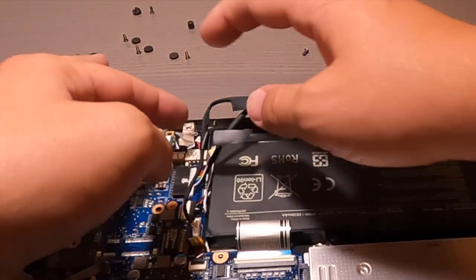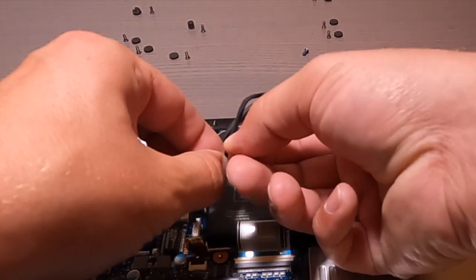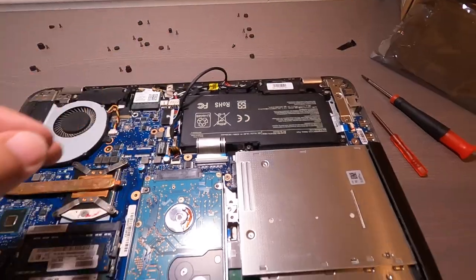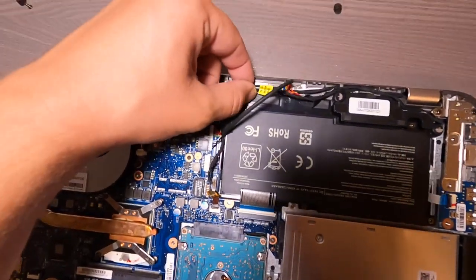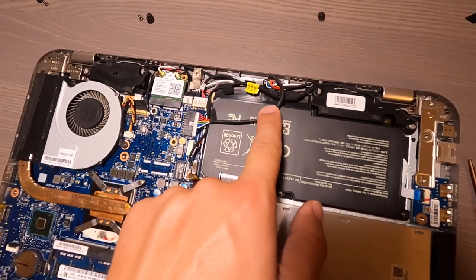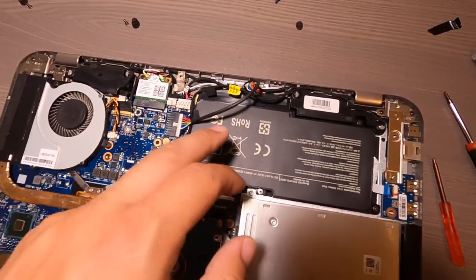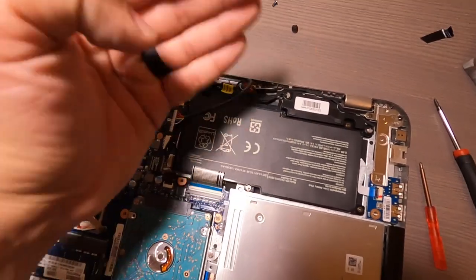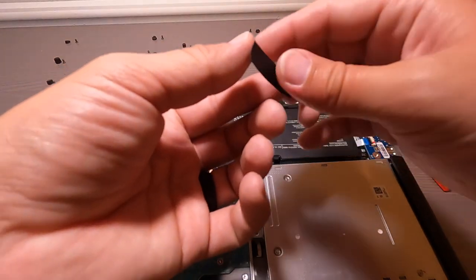So these 2 wires here is some old electrical tape that I probably did from the last time I did this. So I'm just gonna leave that. What I'm gonna do, I'm gonna route these 2 wires just like that. Okay, so I'm gonna route the existing wire here at the back, just like that. Okay, then I'm gonna just leave that down, okay? Nice and easy. It's a lot easier to curve than to flat bury wires, okay? Kind of like plumbing, it's a lot easier to just curve it than it is to completely 90 degree it. You should never 90 degree wires. Okay, so I've got a few strips of electrical tape here.